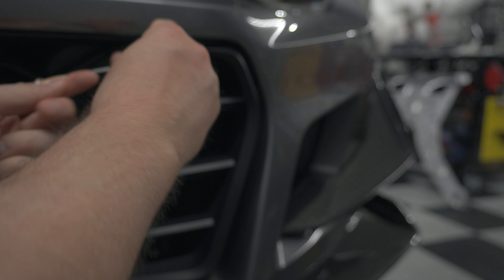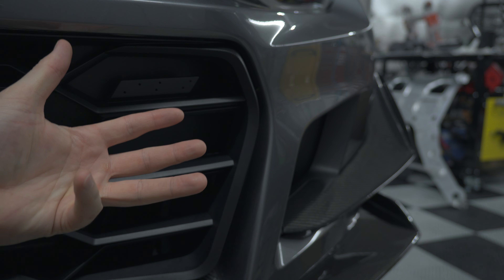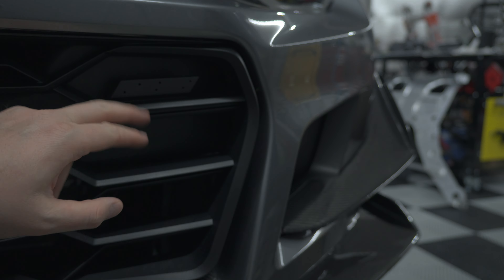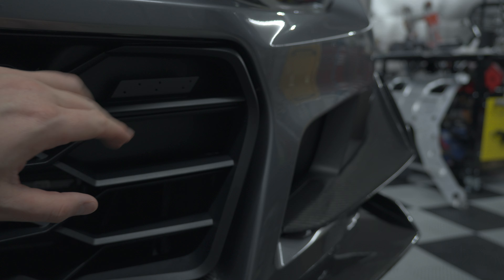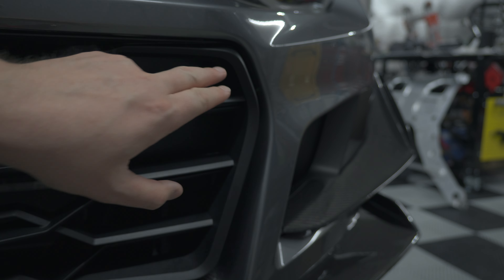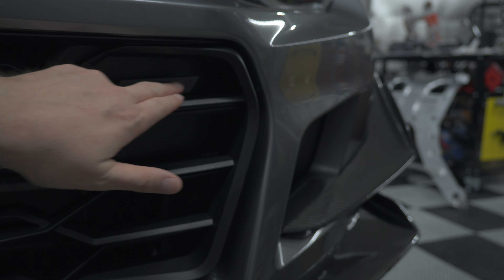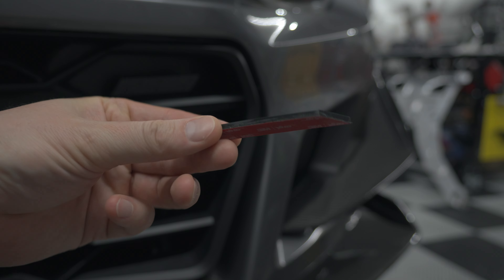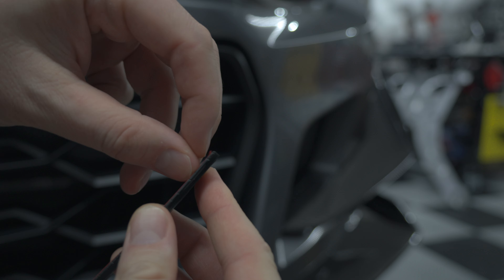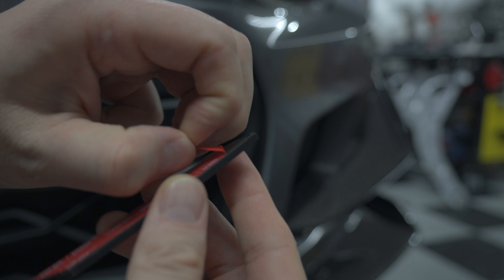Over at the car, got my trusty heat gun and a little bit of dental floss. I'm going to go ahead and apply the heat and see if I can get these emblems to come off without a lot of difficulty. It shouldn't be super difficult because they are relatively small. As you can see, they popped right off — very minimal effort, a little bit of heat, and they just came off. They didn't leave really any residue.